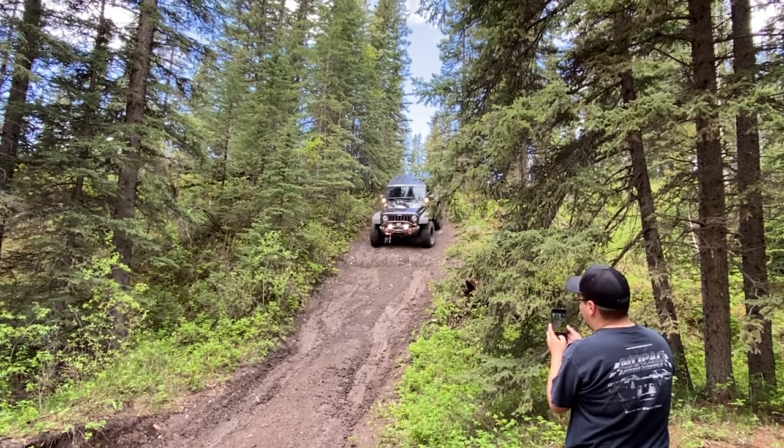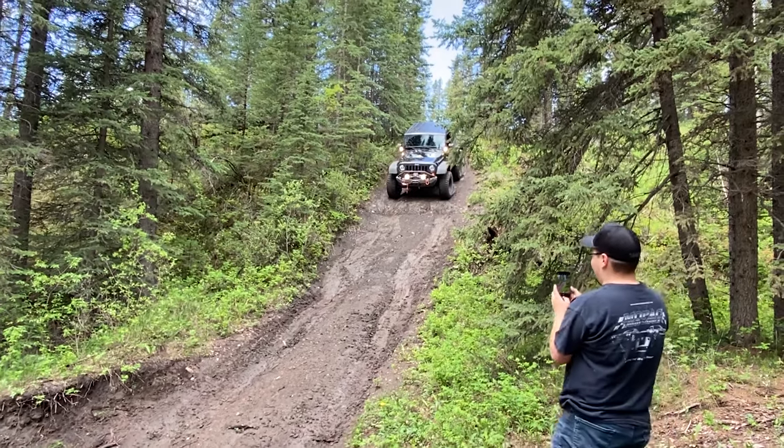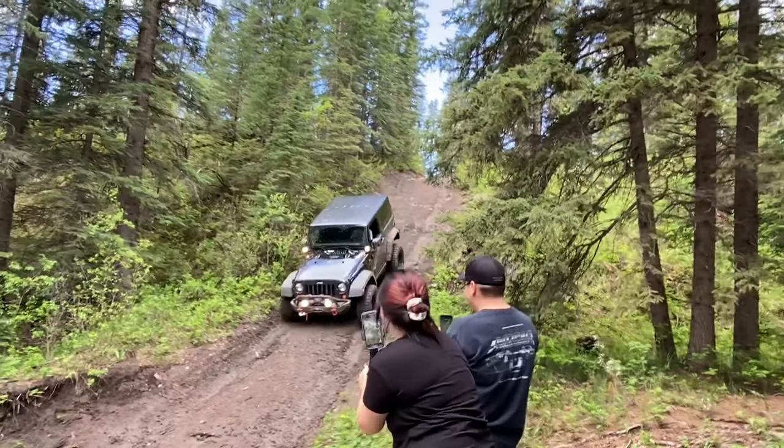The last issue that can be caused by using your brakes instead of the engine can be displayed by this — my worst descent ever. Pay close attention to my front tires. You can see how as soon as my front wheels locked I lost all steering. So if you're on any kind of precarious section where you need your steering, this is the worst thing to do. That's the last reason why you should not rely on your brakes when doing descents — always let your engine do the braking.